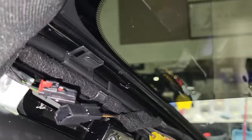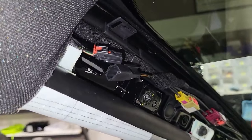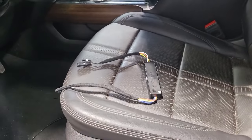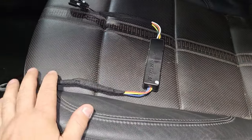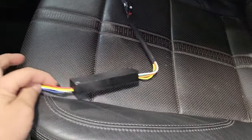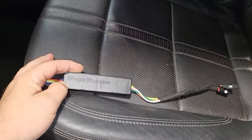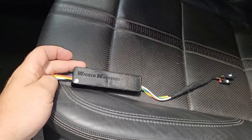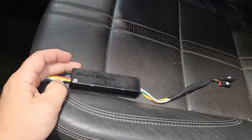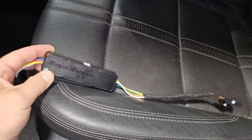Now you're left with your female side and your male side. This is going to go up into the roof — that's our interruption right there. Stay tuned for part two where we're going to install the auto flasher into that interruption. We're back in the truck. Now we've taken the included connector pack, made our connection here, and taped it up nicely to our 18.5. We've got that ready to go on our power control side of this module. On the roof light module, the steady white flood is really not used — you can connect it on the 18.5 and then disregard it at the switch.